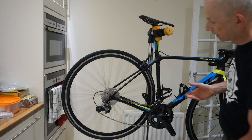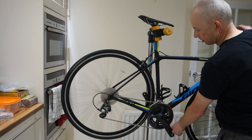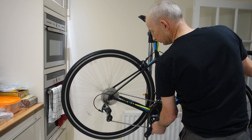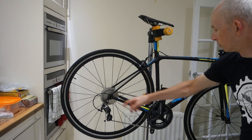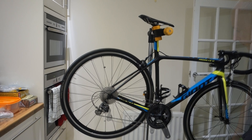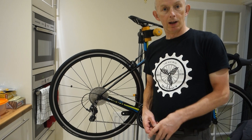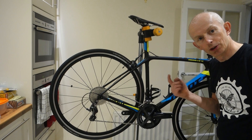The chain is sagging a lot in 34/34 but I'm not going to be running like that. In practice I'm either going to be in big ring towards the bottom or little ring. That seems to work - doesn't seem too bad - and I can go straight back without having to reset the rear mechanism. I was just talking to camera and the battery went flat so it shut off. All done pretty much - can't move the front mechanism down any more because the little metal plate at the back is stuck on a bit too high up.